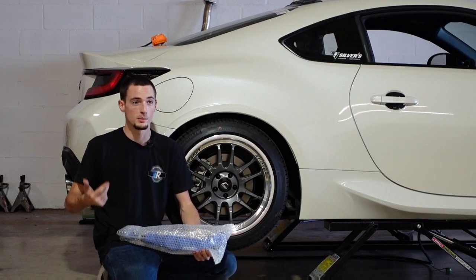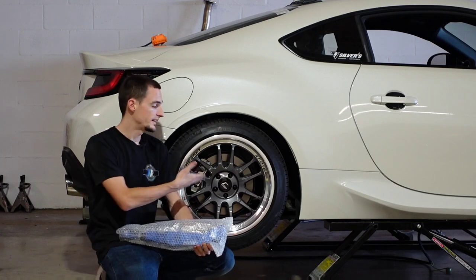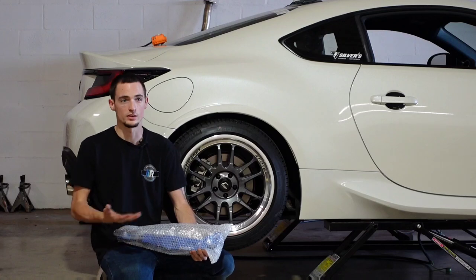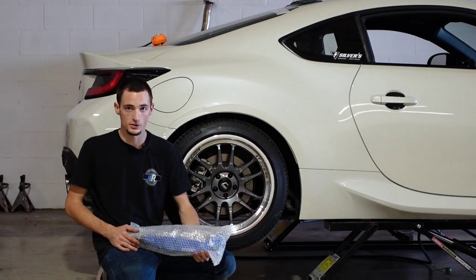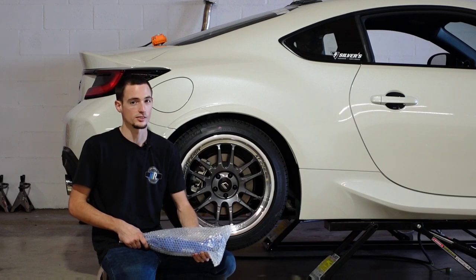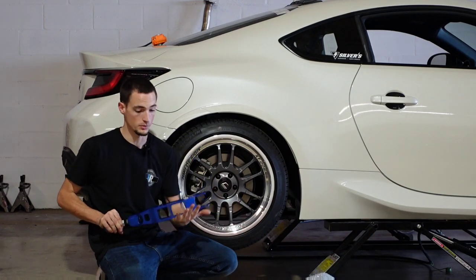Number two, it performs better. But something that can happen is a negative thing — literally, negative camber. You may like negative camber; it may give your car a more aggressive look and you may enjoy the way it looks. But others may not enjoy it and may not want to go through tires significantly faster. So today we're going to be installing some adjustable rear control arms.